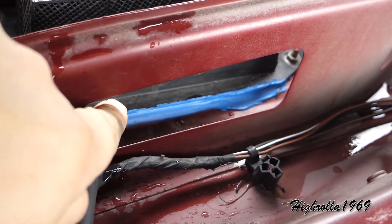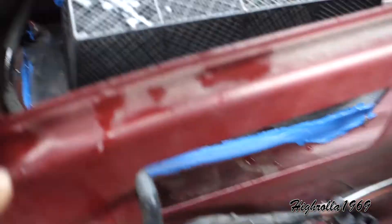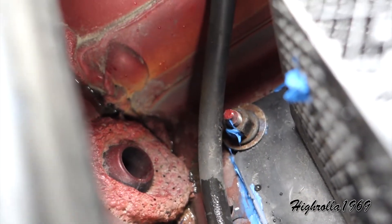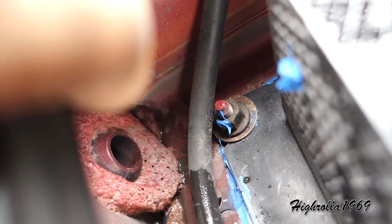There's a poor seal that goes around it, so what I had to do was put RTV sealer all the way around it — the whole entire base of it — that way when water fills up in here it doesn't rise high enough to actually go into the vehicle. Right here is the drain plug I was talking about; make sure that's clear and empty.